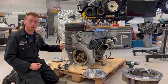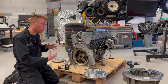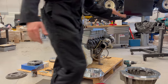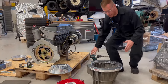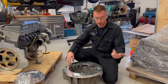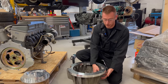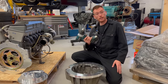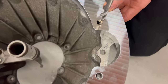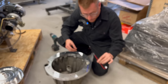Some guys use a smaller fitting from the back — we don't want to do that because we want the strength from these two M10s; it is an actual block fixing so we want to use that. So I'm going to show you how I do it. What we do is we turn the adapter plate using the dowels — this has the dowels in — and then you would bolt the adapter plate to the bell housing. Then take a 10mm drill and drill straight through the two holes that would go to the starter motor, and when we drill straight through those two holes that gives us the perfect place to slide an Allen key through the hole to access those bolts to undo the starter.